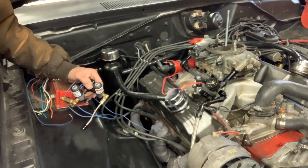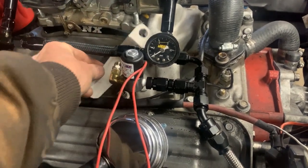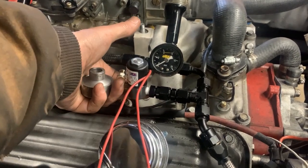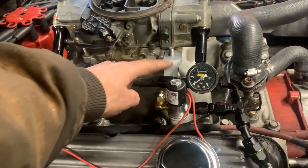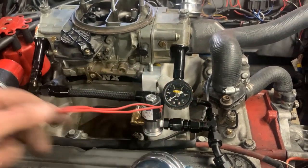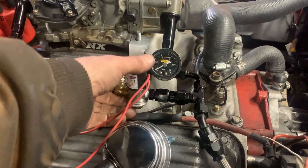I've made a paper template — very simple. The idea is to slip it up there, fasten it to the solenoid with two machined screws, and bolt it to the carburetor base to support everything. I've got this first bracket made now and you can see it fits in here pretty good. The solenoid is fastened at the bottom. I'll remove a little excess material, but this is a nice, rigid setup — the solenoid and fuel lines are very well supported.